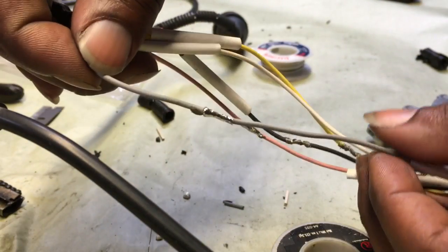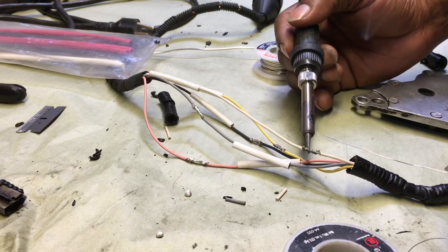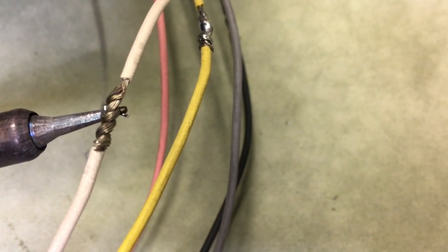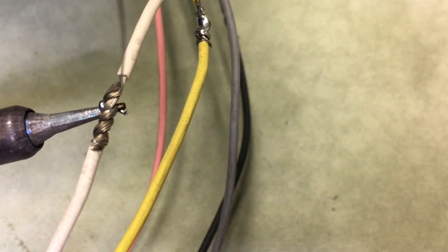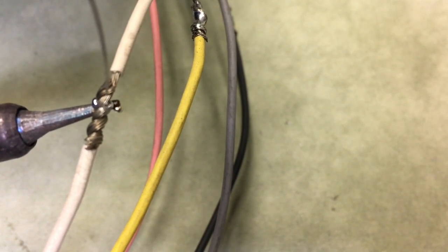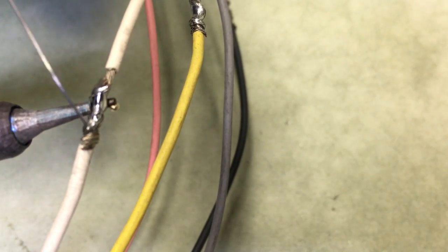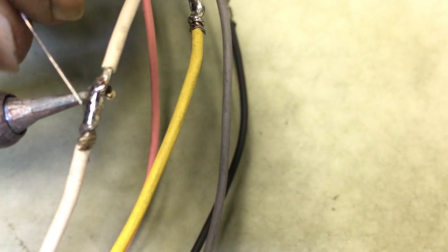About that point is when you know you have enough solder on there — that's great right there, perfect. Tin your tip. I'm supporting the wire with my solder iron tip, making the best connection possible to transfer heat from the tip into my wire, and I just keep working my solder wire back and forth, back and forth. You can see it's starting to melt right there. I just keep walking up and down, back and forth on that joint with my solder wire until it flows all the way in.